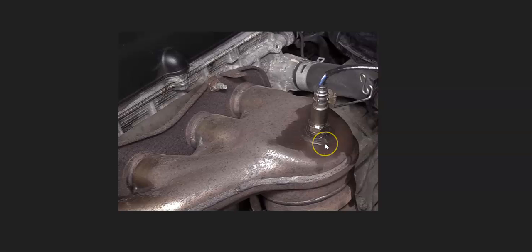If there are no exhaust leaks, the wiring looks good, and there are no blown fuses, then very likely the oxygen sensor has just failed and needs to be replaced. You can test it if you want — there are good YouTube videos on how to do that. Either way, the next step is to test or replace that bank one sensor one oxygen sensor.